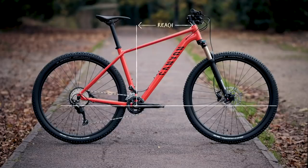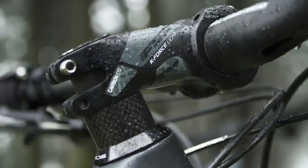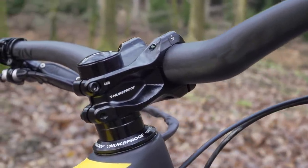I just mentioned reach. Reach technically speaking is a frame measurement, though sometimes people use it as an overall bike measurement. Context is important — a road cyclist might think of handlebar reach instead. Language around this isn't always consistent throughout the bike industry. Something that categorically isn't reach, however, is stem length. Stem length is one of the more interesting subjects in cycling, especially when you consider super short stems, different amounts of trail, offset, and leaning the bike.